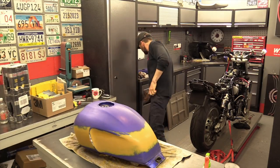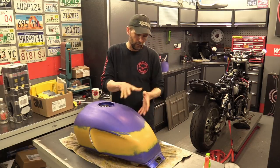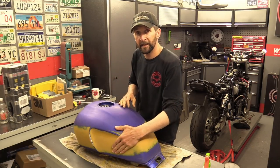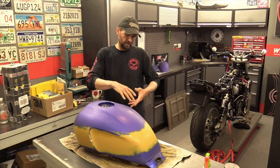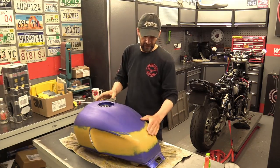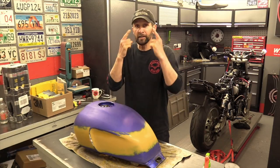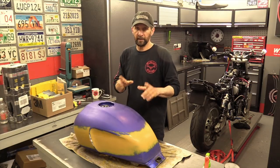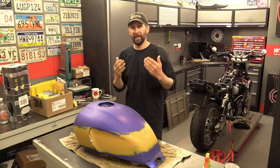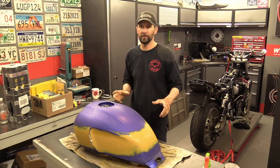Right, okay. So that's rubbed it all down. I busted the shine off everything, knocked down all the edges, and I can't feel any of the imperfections underneath. So where the old pattern, decal lines and stripes were, I can't feel it at all. But what the fingers can't feel, the eye can certainly see. So I need to put a guide coat over everything. One coat of black, just one, over everything, and that is the biggest, easiest telltale to know where there's any imperfections you need to rub out.